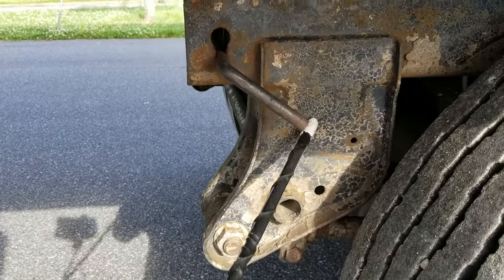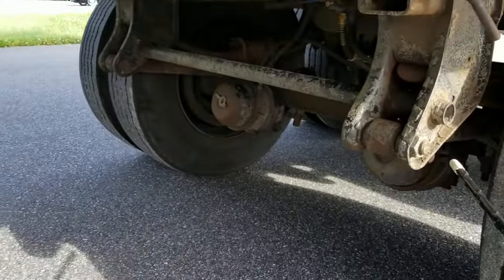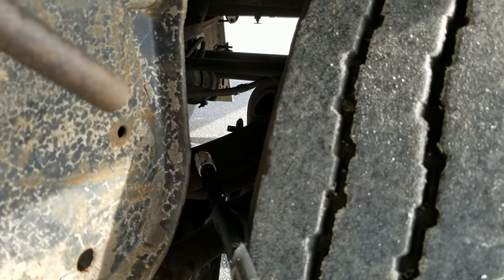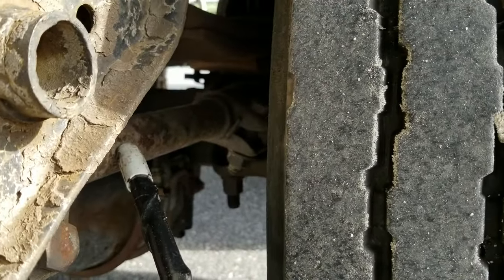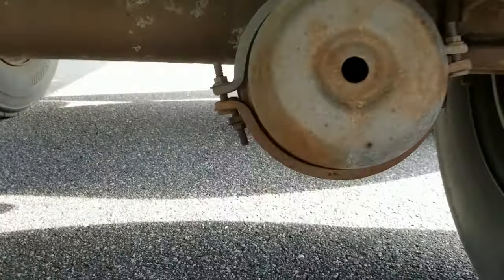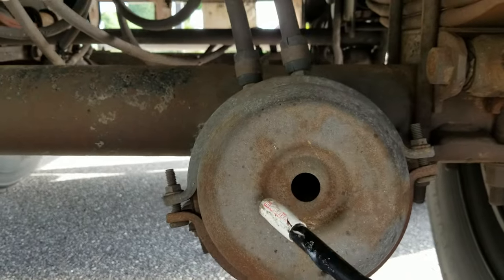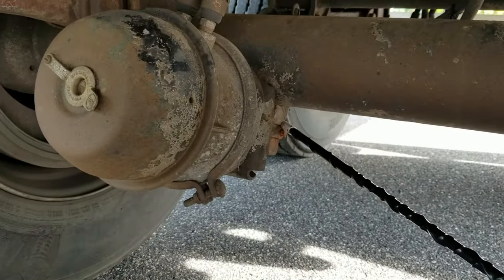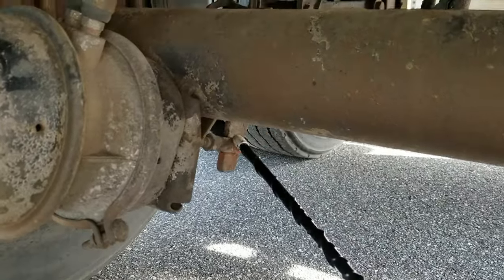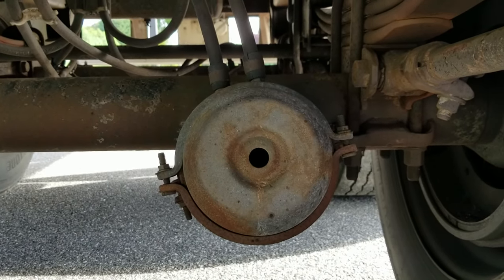I'll move to my suspension. I want to check my spring mounts to make sure it's securely mounted to the frame, no cracked or broken welds. I want to check my springs — make sure they're not shifted, cracked, broken or missing, held on with two tight U-bolts. I want to check my torsion rod to make sure it's not bent or damaged. I want to check my air lines to make sure they're not cut, frayed or dry rotted, no signs of leaks to my brake chamber — securely mounted, no loose or missing bolts, not cracked, dented or leaking. I want to check my push rod and slack adjuster — make sure the push rod isn't bent or damaged, the slack adjuster has no loose or missing parts. With the brakes released, you should not pull more than one inch; one to two needs adjustment, over two out of service.